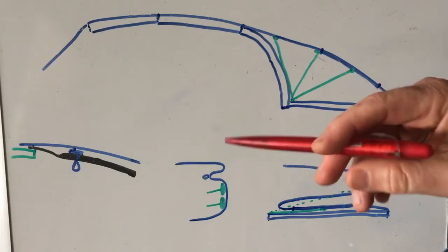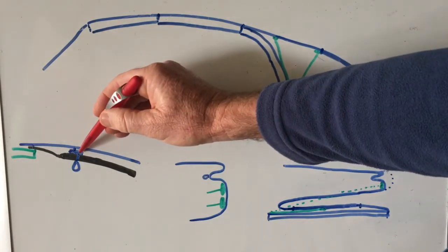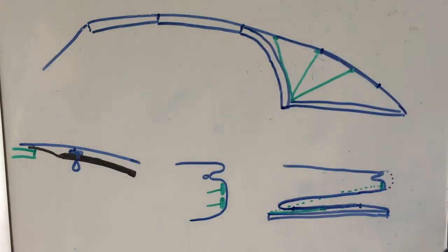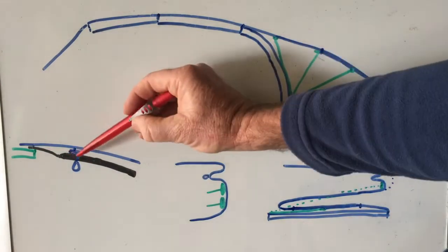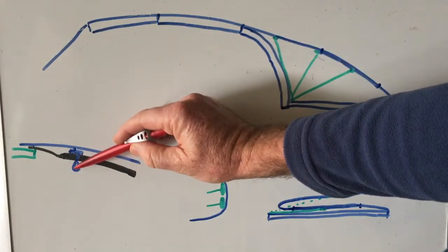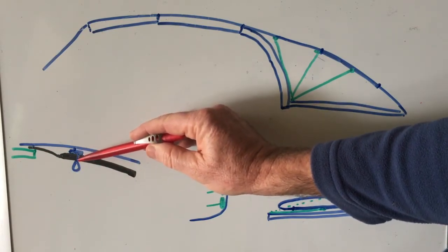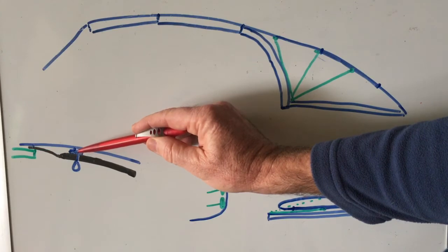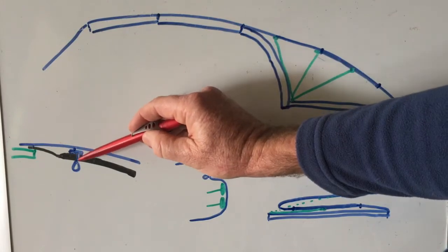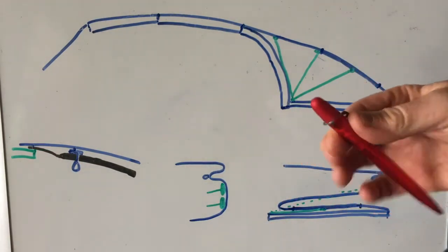And instead of doing what was done in the factory, I've come up with a solution that's a little bit different. So what I've done is I've made up a strip here, and I've used Dyneema, which is a really strong cord. They use it for parachutes and that sort of stuff, and kite boards. But I've made a bunch of loops that run the whole length from one side to the other up here, and the cord's running through there. And the nice thing about that is instead of this pulling on that and relying on this stitching, I poke these through that noise insulation layer, and now when I pull on that, it's pulling on this piece here. And then with that glue, it's just going to pull the canvas down in the right place.